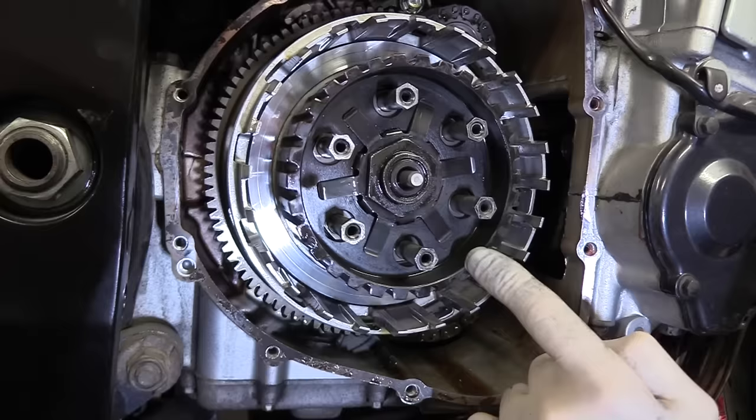And the idea is if you stick the gasket to the casing and then you just put regular grease on the face between that and the engine casing. So the engine casing itself, if that's got gasket stuck all around it, trying to get it off when it's on the engine case with all bits dropping into the clutch, it's just a pain in the backside. If you can put it on the bench and stand there and scrape that off nice and cleanly without any of it going in the engine, it's better to do that. So if you stick the gasket to the casing, then when you take it off in the future, it all comes off connected to the casing and none of it remains on the engine.